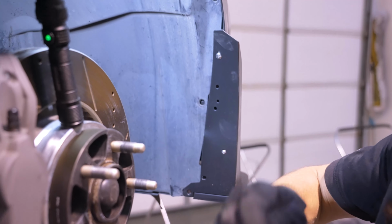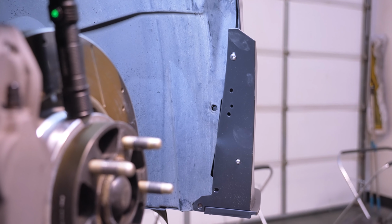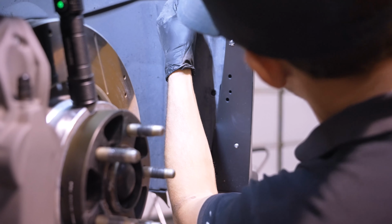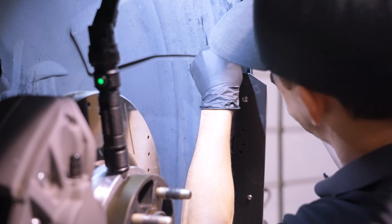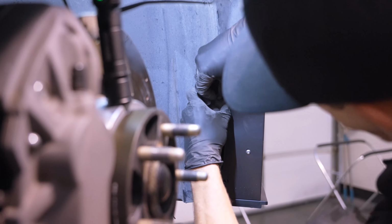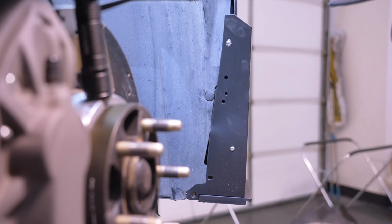So I've got our liner started. It's the same as before. I wanted to note the changes to the new bumper. We've got 3 connections that tie into the bumper. We've got this top one. These use the standard ones that came out. The middle one is also the same. It's sometimes easier to reach behind here and pull this one out a little bit so that you can get that one started, push it in, and then it'll kind of settle where it settles.